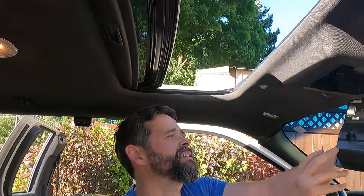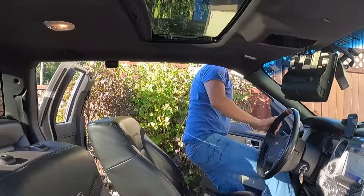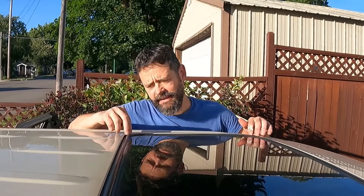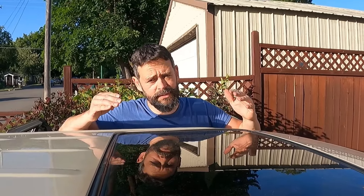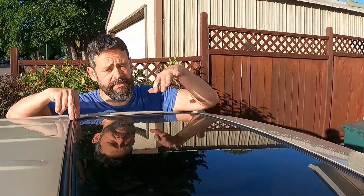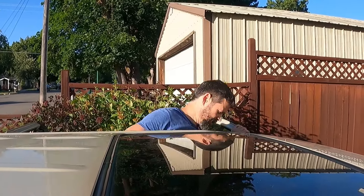Let's try to tilt — we're not done yet. Oh my gosh, it's freaking working! Let's go all the way. Good night — oh my gosh! Let's look at the top and make sure it's going all the way flush, because this is where you can adjust. We need to adjust this — it's got a big gap right here. So we need to take it back apart slightly. We weren't sure where the flat point was, which is why we didn't go crazy with the adjustment upfront. The front looks pretty good too. All we've got to do is loosen those two back bolts, raise it up to where we like it, test it one more time, and then we've got it.